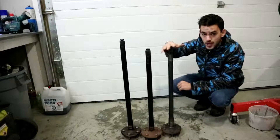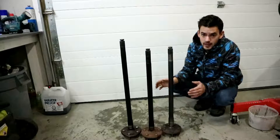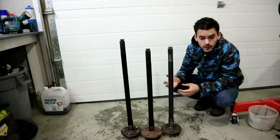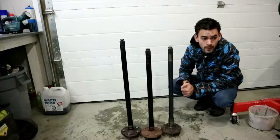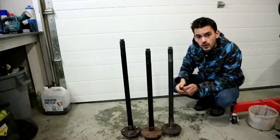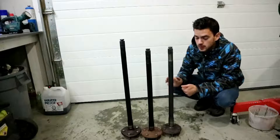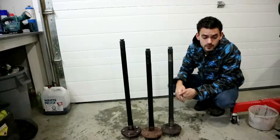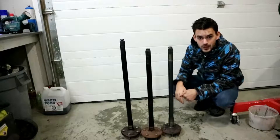In order to run this shaft, we've got to take and cut that three inches out of the driver side axle tube, then jig it, square it, and weld it back together again. Jocelyn's going to come over and give me a hand. We're going to pull the ring gear out of our housing and then take it over to my dad's place so we can cut it, jig it all up, weld it and make it equal length so these guys fit.